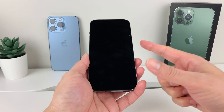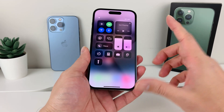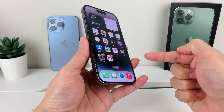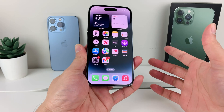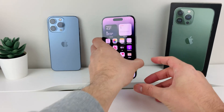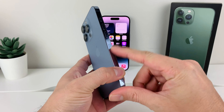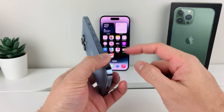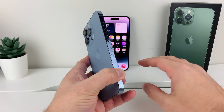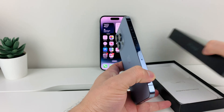After you've done that and you're still having issues — still getting the same errors, or not getting any phone service — the next thing you can do, if you have a phone with a physical SIM card, is reseat it. On the new iPhone 14 models in the US there is no longer a physical SIM card, so you can't do this. But if you have an older phone like the iPhone 13 or anything older, you can take out the physical SIM card. The SIM tray is on the left-hand side, or the right-hand side depending on your model.